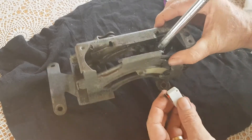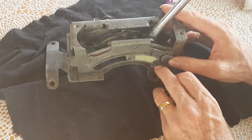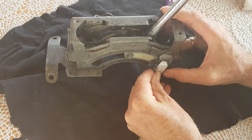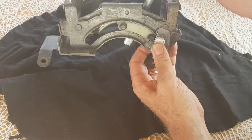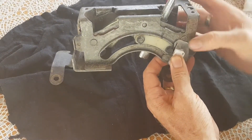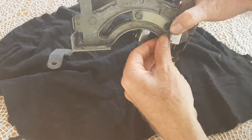The idea is we're going to take our switch and press it so it fits in the position I want it. This is actually going to create a nice little mold as well. You can see it's already starting to turn white. So there's our switch — we take the park position. Look at that — we've created a park or neutral safety switch. Now I'm just molding this stuff to really lock the unit in place. Obviously you want to free up where your spade plugs and everything else go on. If you mess up, simply just stick it back in the water and you can reshape it again.